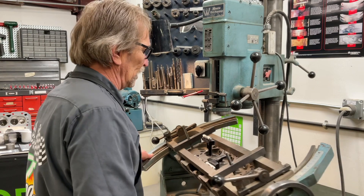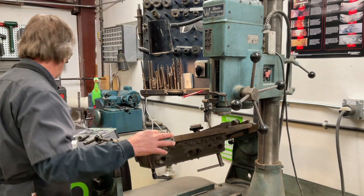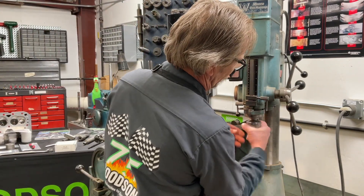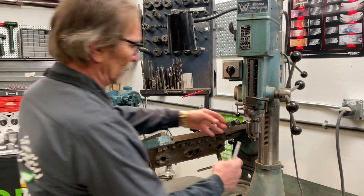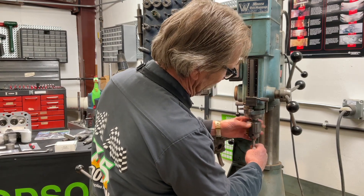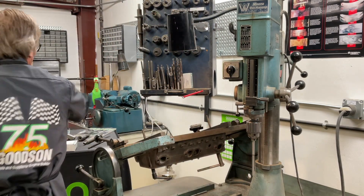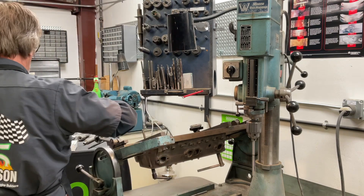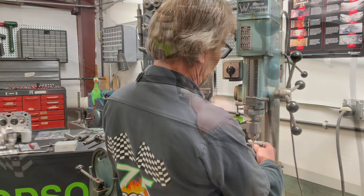I first need to air float this table out of my way because I don't have enough room for everything I need to put in here. This particular machine came with a drill chuck, number three taper — I just stick it right up in there and lock it into position. I can grab about any valve guide pilot that I have here. Just a quick snug, maybe grab your wrench and give it another little snug. And then I can take my valve guide level — it's got that V groove right there, and I can clip that right on.